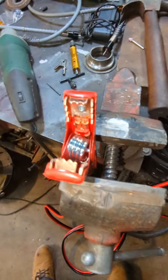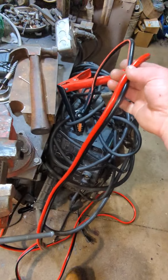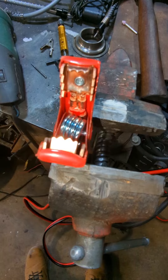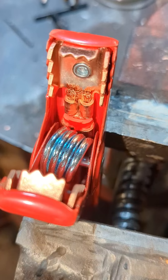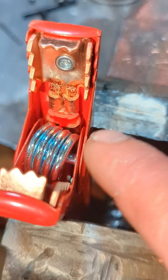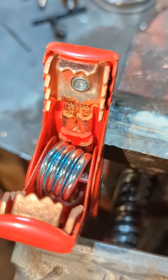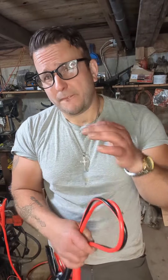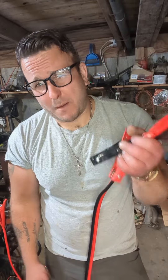I've got one opened up in the vise here. Another way you can tell if it's aluminum — if you can't tell by how light it is — is you'll see on the cut end of the wire how silvery and shiny it is; it's not copper all the way through. You can kind of see it here that it's a different color on the very ends of these little strands. Aluminum is a great conductor, especially copper-coated aluminum, but very small strands of aluminum like this do not work — once you get down past a certain size, aluminum turns into dust and almost evaporates it corrodes so quickly. Unfortunately a lot of what we're buying nowadays that requires copper has electroplated aluminum thrown into it.